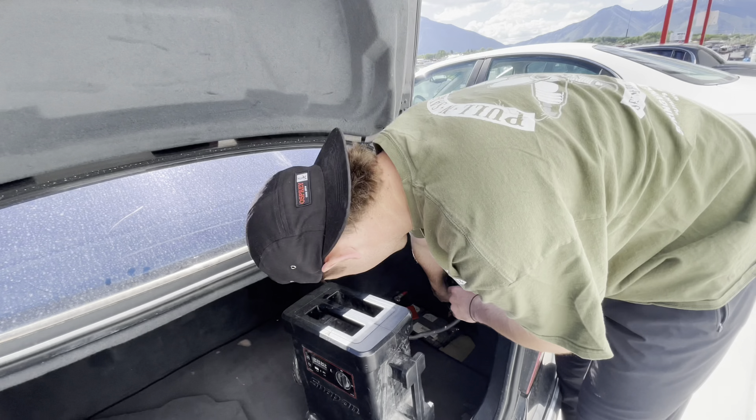Climate control doesn't work. The fan isn't working — same 40 amp fuse we're dealing with in the front of the S55. Kind of a common thing, not a huge deal. The biggest deal is why won't it rev over 3,000 RPM and it doesn't have a check engine light. And it doesn't say it's in limp home... oh, it is in limp home. The ABC light's on — ABC, drive carefully. Drive to the workshop.